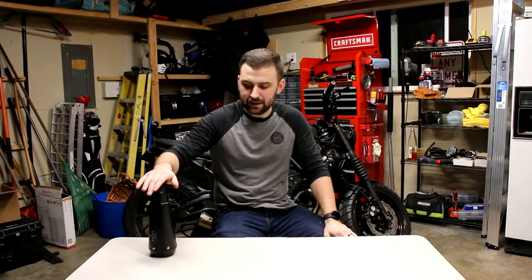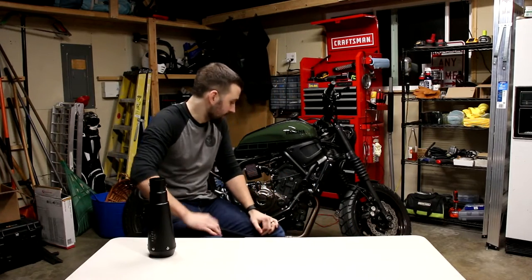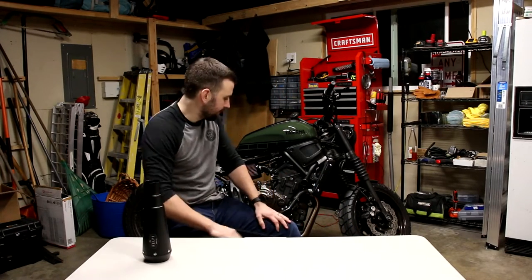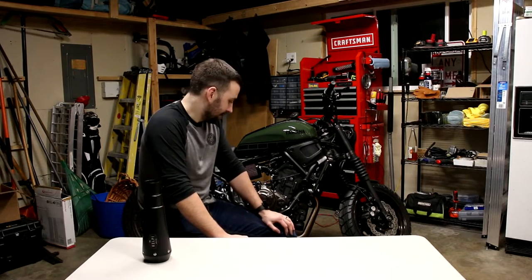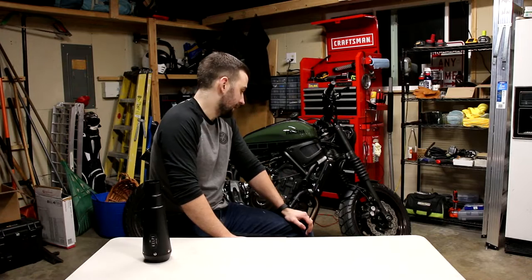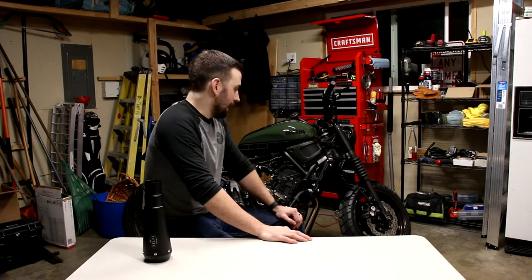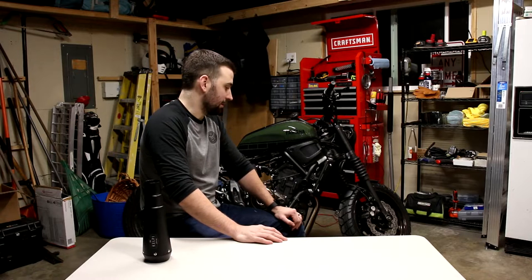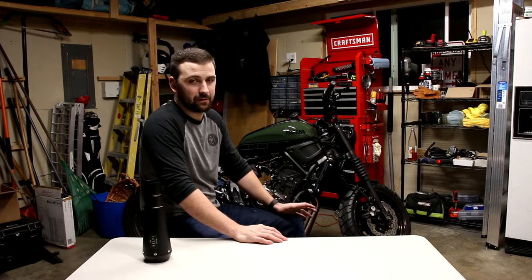The reason why I'm installing this today is because, one, I've always wanted a black exhaust system for my bike to kind of tie the whole look together. And two, because I've never been very happy with this SE Project exhaust. It was a lot quieter than how it was going to be originally. And also after having it dyno tuned, I found that this exhaust is actually very restrictive — it wasn't getting the performance that I thought it would. Even with a full tune, having it dyno tuned multiple times, it gets less horsepower with this exhaust than the bike does from the factory.